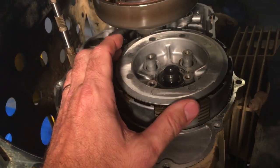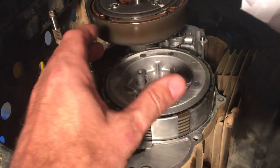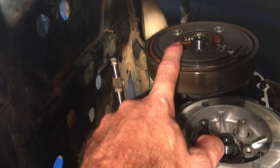This clutch plate basket isn't a big problem — it's only $35 and it's easy to slide right up and on and off — but to get at it you need to remove the centrifugal clutch because it overlaps it. That's where my problem is: getting this nut off.